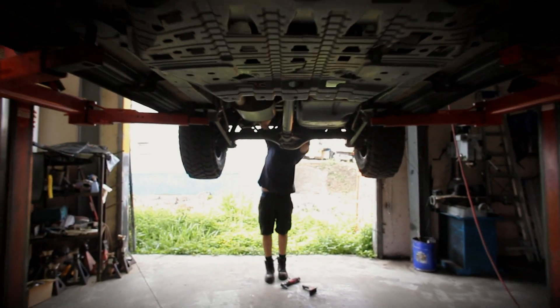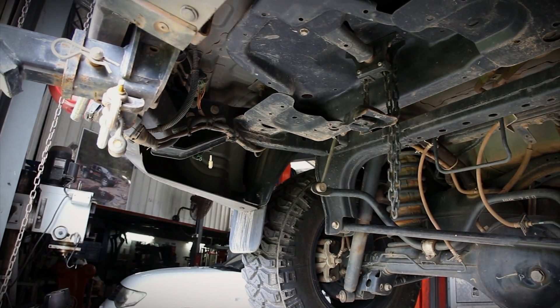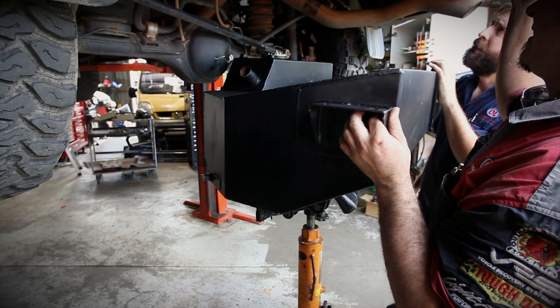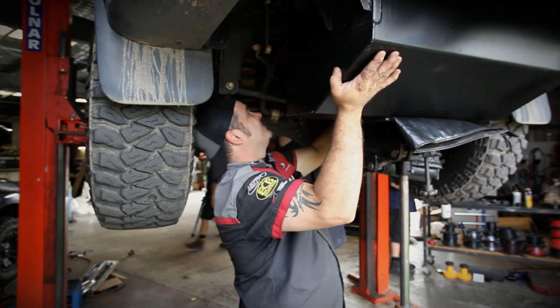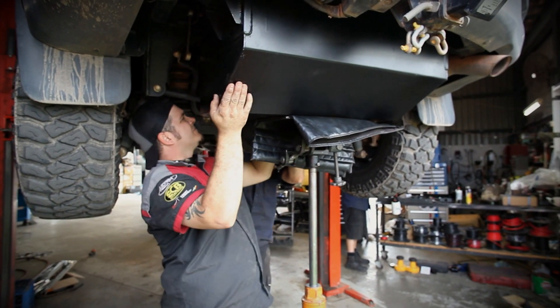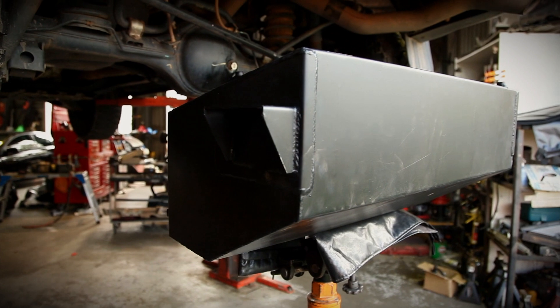Our plan for the MU-X is to make sure it's got the fuel capacity. At the back, where the spare wheel goes, there's a massive big void. Because we've got bigger tyres on the MU-X, there isn't enough space to fit the spare tyre in. So what we're going to put in there is a Brown Davis auxiliary tank — a 95-litre tank with a pump inside it. It actually transfers the fuel from the 95-litre across to the standard 65-litre tank, so you're going to get some serious range. The Brown Davis auxiliary tank is made out of aluminiumised steel, which makes it tougher — I reckon twice as tough as the standard tank, so you can take a bit of a knock and keep on going.